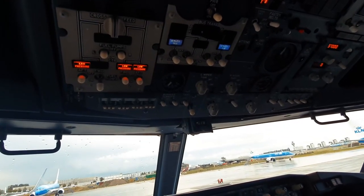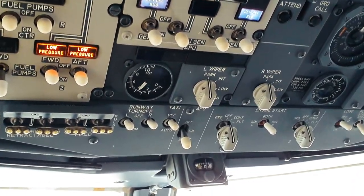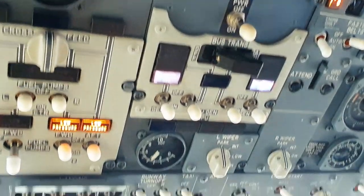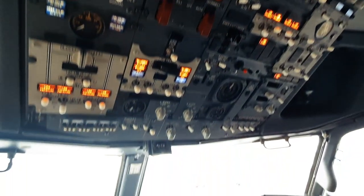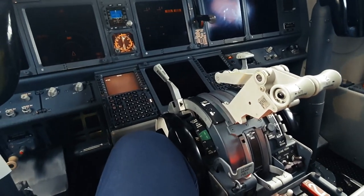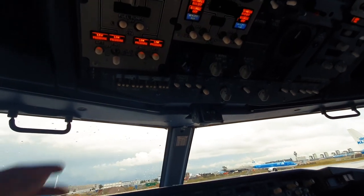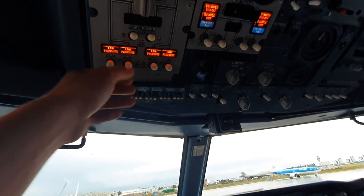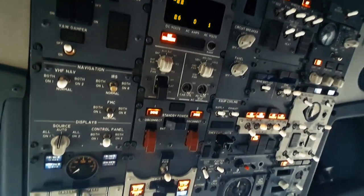Because this airplane is going into longer-term storage than normal, we don't have ground power connected, so we're gonna turn off the APU. Everything will go off — the APU is still on, currently in a cool-down now. This AC pump can also go to off. And now we're on DC power.